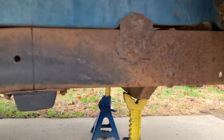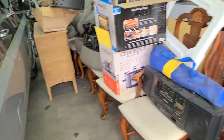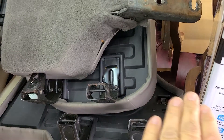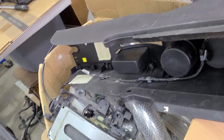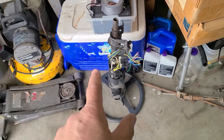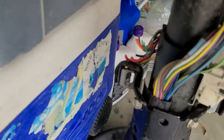I'll go over a couple of things in the interior — got some cool stuff from a wrench-it pick-apart. I have a 60/40 seat from a Jeep Grand Cherokee; these brackets will bolt to the seat riser in the floor. I got the leather seat 50% off for 20 bucks. I also got a Pontiac Grand Prix floor shifter and center console which will work out pretty good — I'll probably cut about half of it off because of the seats, but it'll work with my 4L80E. And I got a Pontiac Fiero steering column, which is shorter than a normal Camaro or S10 column. I'm going to shorten it even more, but it has a little pedal where you can lock the ignition — which is cool.